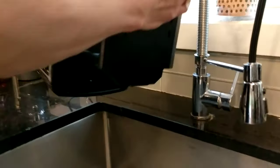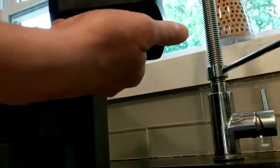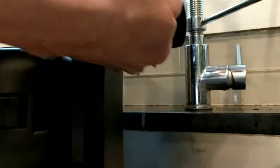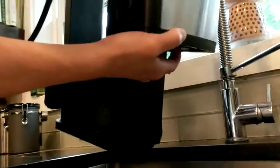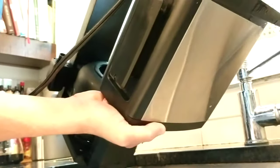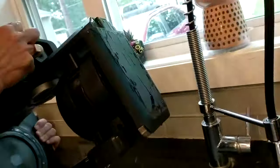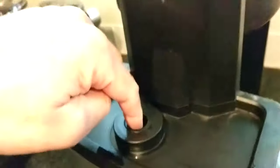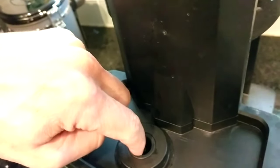Be careful — there are some parts that are still hot. Now this is the important part: you take your finger where the reservoir goes in — there's a valve. Stick your finger in and push on that valve and you'll see the water coming out. It comes out not only from the valve but also from the top of the machine. Now just kind of rock the machine around. At some point you might hear the sound of some air being drawn in. Press on that button to let air in and water out.